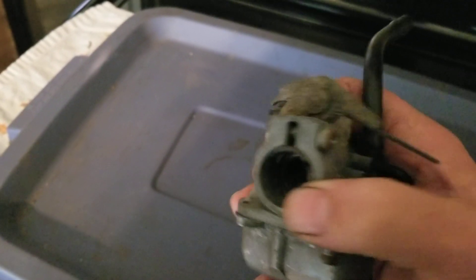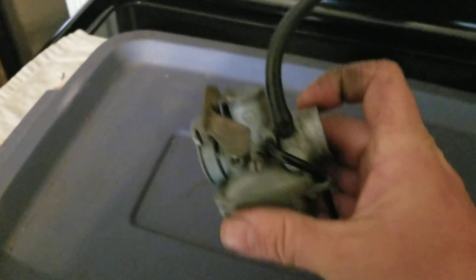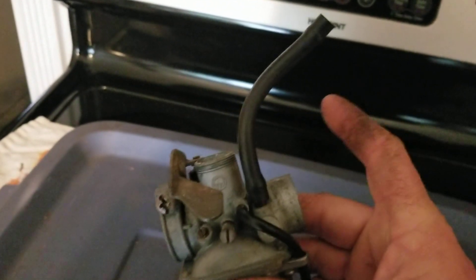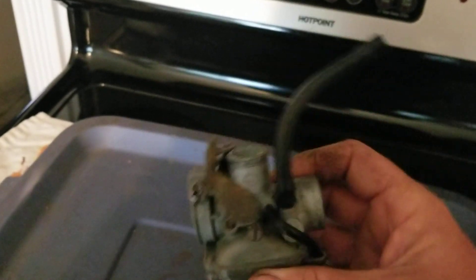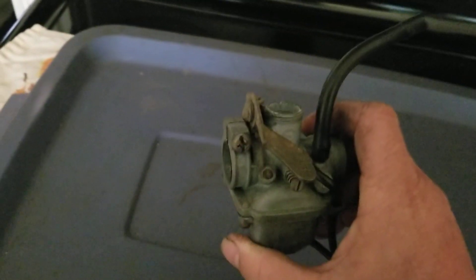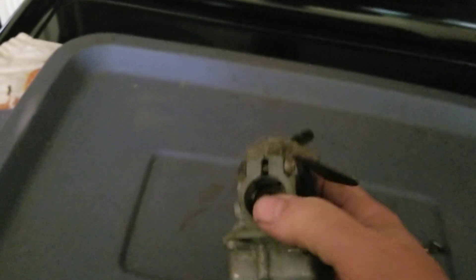I'm going to assume I didn't clean it. I do know that the insulator is smashed and broken. What happens is when the air filter is connected but it's missing the bracket, it will rock back and forth with the bumps. On the KV75 they put a bracket on the end of the air filter, and on certain bikes the carburetor is holding all the weight of the air filter - these are very common to break. They get old, they get crashes.